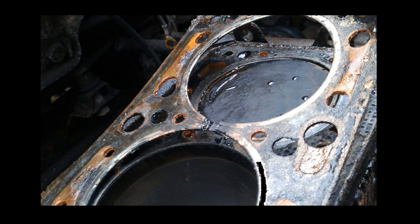Since I had white smoke coming out of the exhaust, that's an indication that coolant — remember those coolant passages that go up into the head — that the gasket isn't keeping the coolant separated from the cylinder. Some of the coolant is actually leaking into the cylinder and blowing out of the exhaust as steam. And last but not least, I noticed that the oil in the valve cover was a little on the milky side — instead of just being brown like maple syrup the way oil's supposed to look, it was actually white colored. That's an indication that it's been mixing with water, a.k.a. engine coolant. So that's the whole deal. That's why we did this compression test, and that hopefully explains what a blown head gasket is and why it's not good. Now all we've got to do is keep taking apart the engine and replace the head gasket.